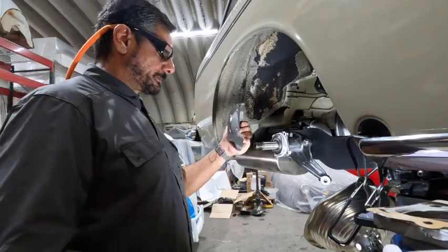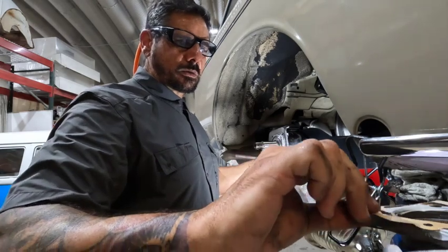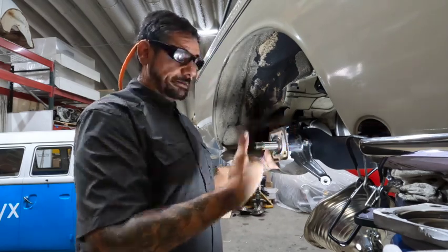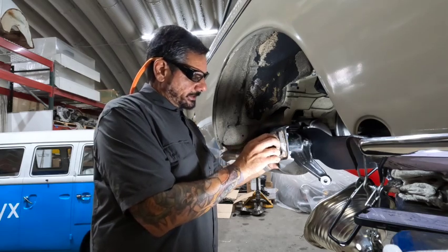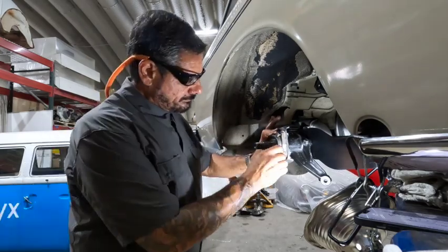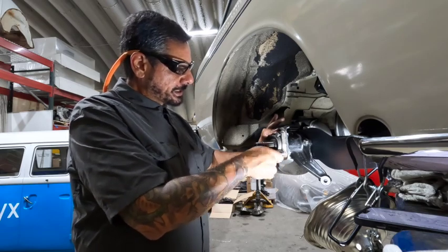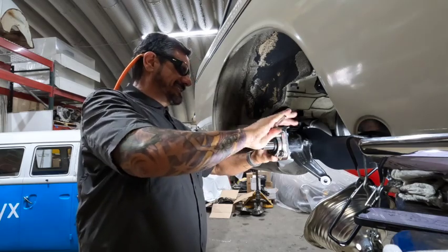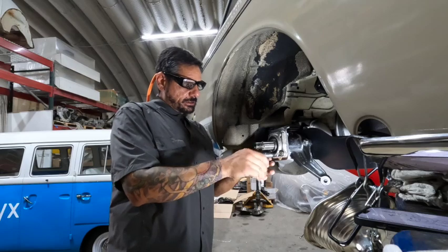Caliper mounts go to the back on the install. Put that in place, get our paper gasket on that. I'm holding this in place with my left hand, o-rings already in place, bringing that sucker up to it. I'm going to snug one of these up so it holds everything in place. Put two on before snugging to make sure you've got it lined up properly - if you only put one on you might be severely disappointed when you go to put it back on. We're going to our without-guesswork book to get the torque spec.